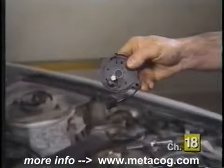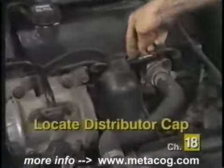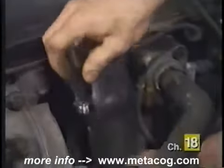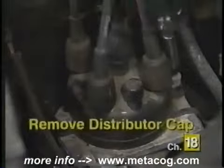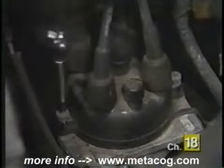Let's replace a typical Chrysler Hall effect switch assembly. The Hall effect switch assembly is located in the distributor underneath the cap and rotor. Locate the distributor cap by finding a spark plug and following the spark plug wire to it. Some vehicles may have a splash cover over the distributor cap and wires — remove the splash cover to gain access. Remove the retaining screws and lift the distributor cap off, then move it aside to gain access to the rotor.